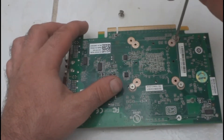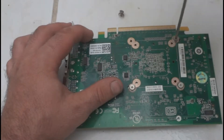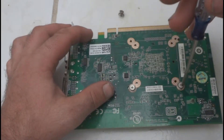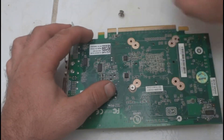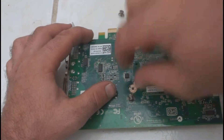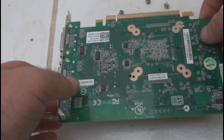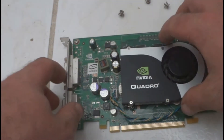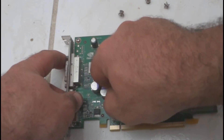Try not to slide it around too much and do not press very hard with the screwdriver. Once you get the four screws out, carefully turn it over. The heatsink came off — usually it will stick because of the thermal paste. Also unplug the fan here; gently wiggle it out.